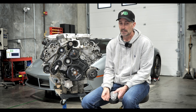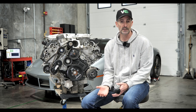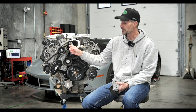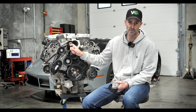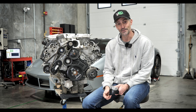So what does that all add up to? On a stock blower with our upper and lower pulleys, the vast majority of the time it's fine — unless your tensioner is weak and worn out. That's largely due to the grip tech coating on the upper pulley. But as you go smaller on the upper pulley, the tensioner condition becomes really critical. And a lot of you are probably reaching the stage where your tensioner is worn out and needs replacement.